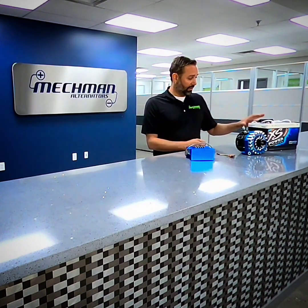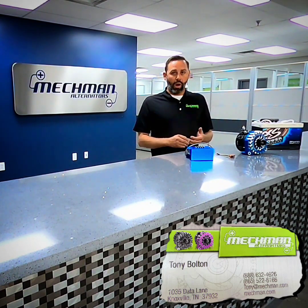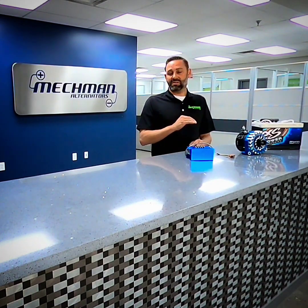If you need that extra voltage — primarily, if you have a 12 volt battery, a good 12 volt AGM or lithium battery, and a properly sized 12 volt alternator — you're going to be in the 14.5 volt range. We have a lot of tuners, a lot of racers trying to increase voltage to fix other problems, like a band-aid over RPM or poor wiring. A properly engineered 12 volt battery and alternator with enough capacity will run even the most extravagant pro mod.